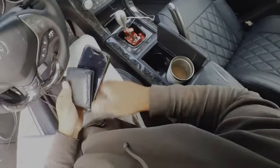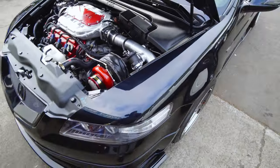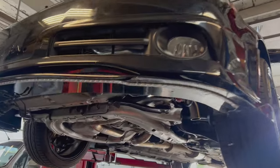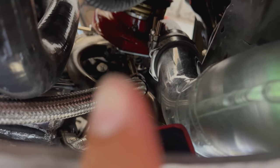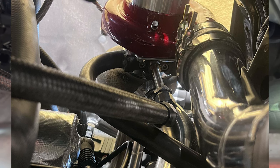I tightened that up when we got it back from the fab and it hasn't leaked since. Gonna try to fix that oil leak. Worst case is the tranny slipping up pretty badly. She's back on the lift — don't want to take it home dripping oil. Found out why it was dripping oil. There's an Allen bolt right up in there — looks like one of them backed out. I went back on the photos from the fabricator and it had two Allens in there. So it just looks like one Allen backed out and that's why it had been dripping oil.